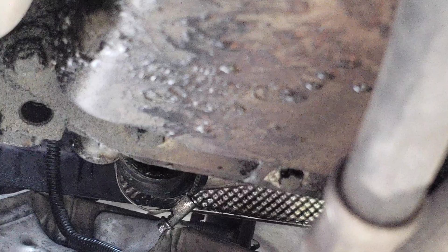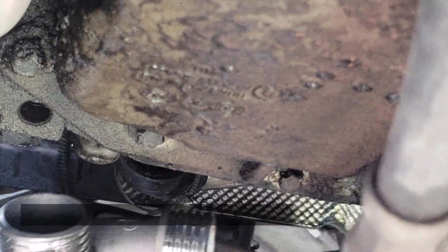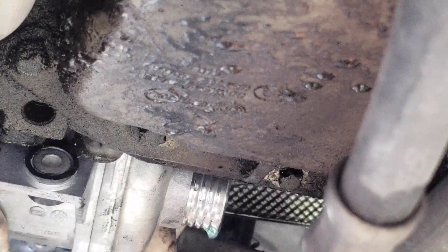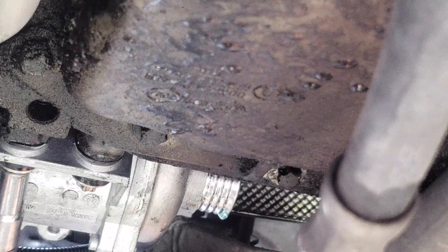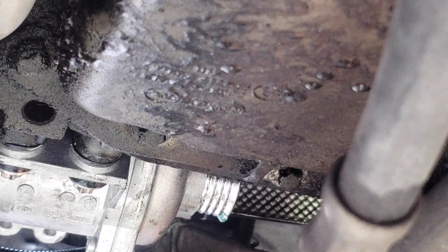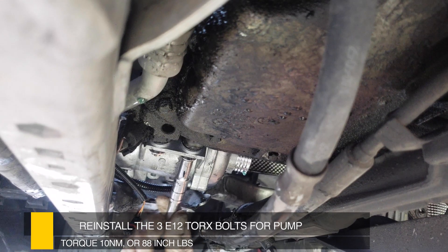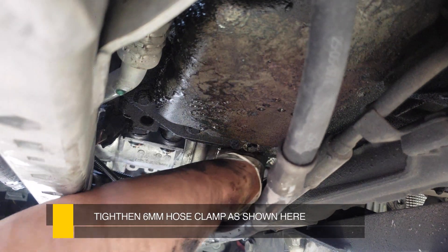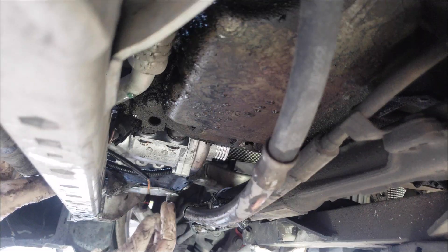Putting the factory replacement back in. I went in there and primed the pump — I poured a little bit of coolant into the pump because that's what you're supposed to do. Now we're going to get this other bolt up in the top. Tighten up the six millimeter. Water pump is officially in.